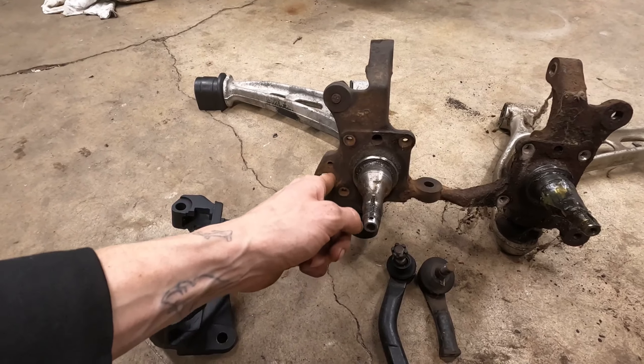We got our two rears. Everything through the ultrasonic cleaner makes real quick work of all this stuff — everything just looks so good and clean. We got to assemble, throw pistons back in and the rings. Obviously the old ones are garbage, and you can see just how clean these new ones are — the ones I got that I need to rebuild. These are vented rears with fins; the standard S5 rears have no fins. Everything's cleaned up. Let's get to slapping these together.